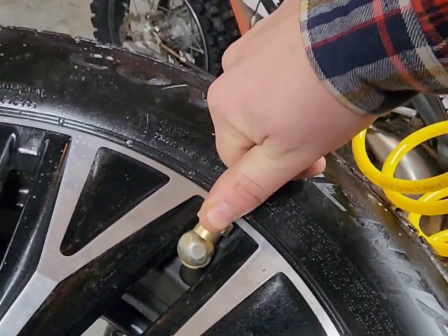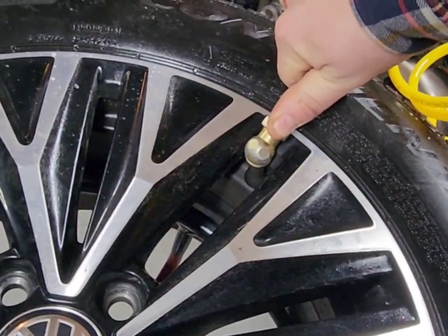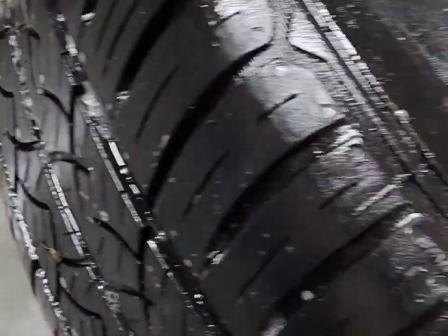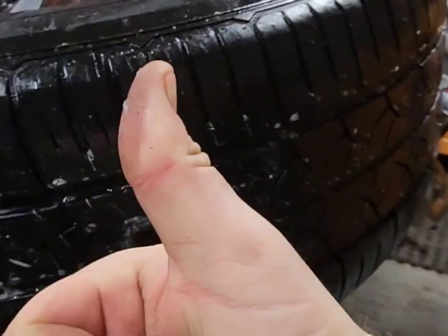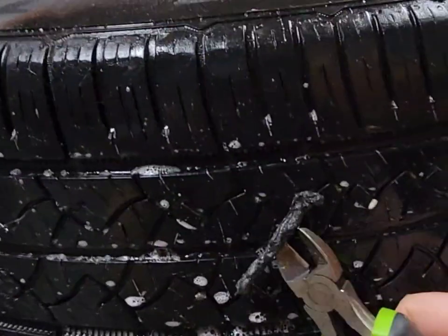Pull it out — it's in there with some excess. You want to make sure there's excess. Then you go and add more air to your tire. Make sure you put in the amount of PSI that is good for the tire. You can see there's no air coming out of where the plug is. Keep adding the air, then give it the soapy water test — there's no bubbles, so that's good.